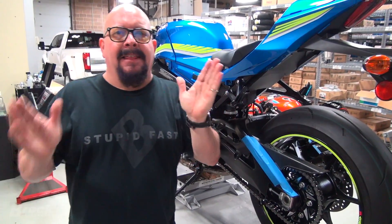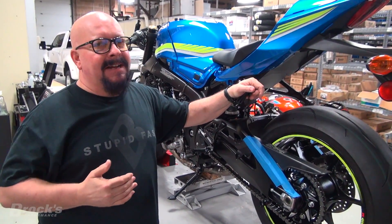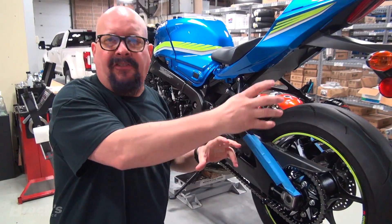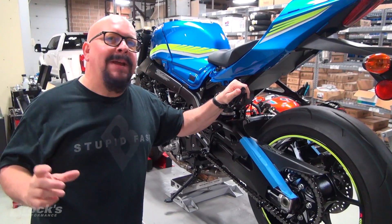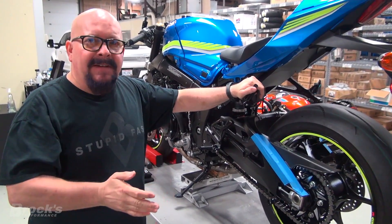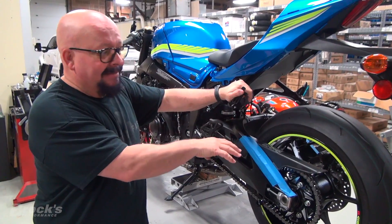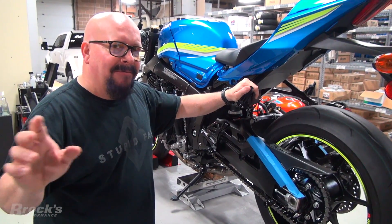We are drag racing - that does not fully apply here. You can't get rid of the physics of the motorcycle, but we're making concessions. Any little swing arm adjustment, or if we change the sprockets - which changes the attack angle and changes the swing arm length - there's a reason there are books this thick dedicated to all this. We're going to try and simplify it. We want to get the bike as low as possible to keep wheelies down. We still want traction. We are not going to have any traction problem on a motorcycle like this with a short swing arm.